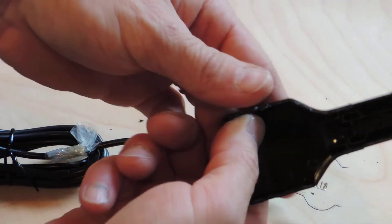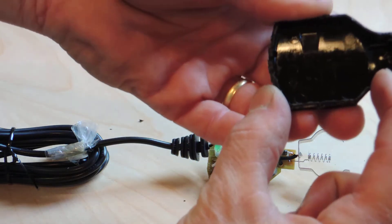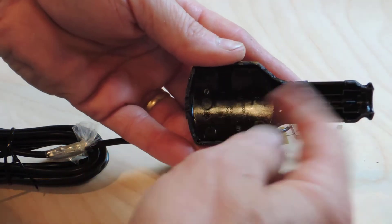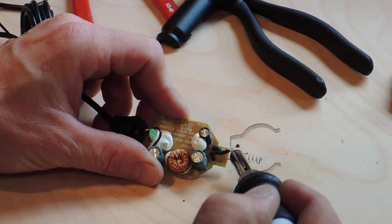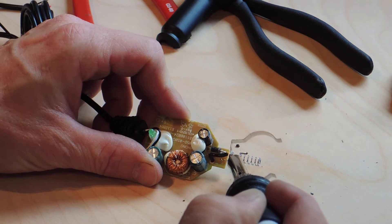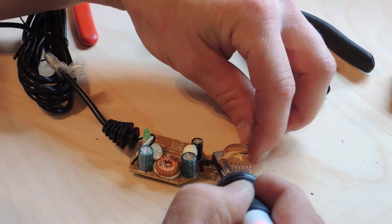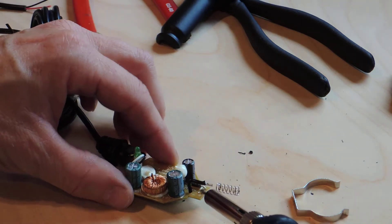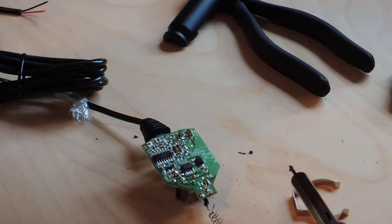What this buys me is I can reuse this case but cut it off right here with a Dremel tool, leaving only that small area to bury in the bike — I'll wrap this opening with tape. I'm trying to get the soldering on camera but my solder doesn't quite reach far enough. I just need to desolder this wire once it heats up. There — I just desoldered that. Now I'll desolder the spring pin as well from this side, using pliers since it will get hot.